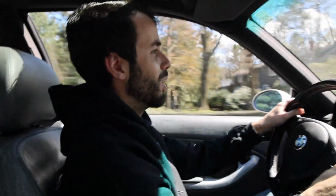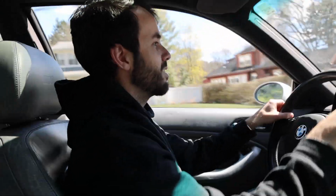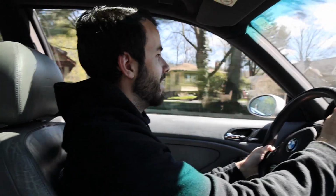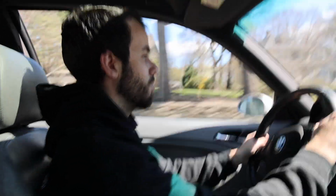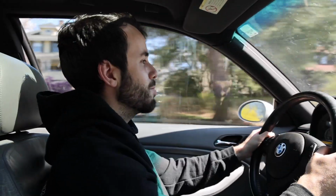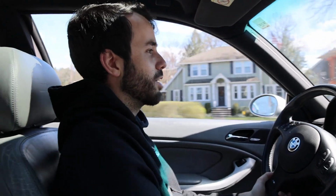Yeah, I think you're going to have a lot more fun with this. It's really darty on turning. The dead space is still there, but that initial bite is really nice now, and that has to do with the alignment spec more than the coilover, I guess. But this is my first car with a lot of front camber. Everything else I've had is either all-wheel drive or front-wheel drive, so you don't want a ton of front camber.